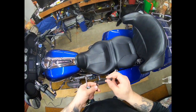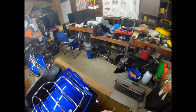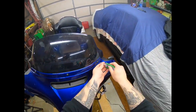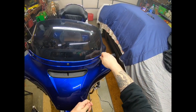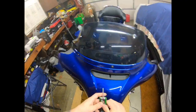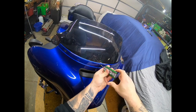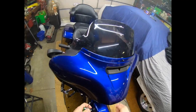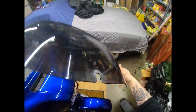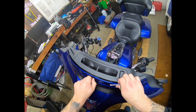You're gonna have four different screen screws — two long and two short. The two short ones go on the bottom and the two long ones go on the top. Next thing you want to do is take these two screws off first. Then loosen your middle one but don't take it all the way out, because that screw is holding your fairing on. Leave it for now. You should be able to take your windshield up and out of the way, set it aside, then take that last screw the rest of the way out.